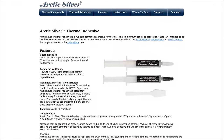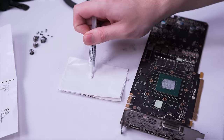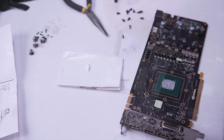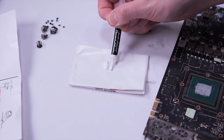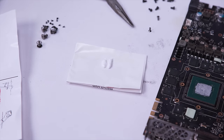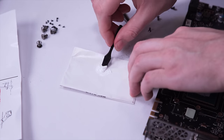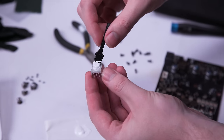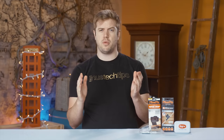Which brings us to our third and final handy sticky product: Arctic Silver Thermal Adhesive. This stuff is the real deal — it includes a warning stating that yes, it is a permanent adhesive. Components that you attach with Arctic Silver Thermal Adhesive will stay attached forever. Your 7 grams of thermal adhesive is split in 3.5 gram parts across syringe A and syringe B. You need to mix these parts like an epoxy in equal 1-to-1 ratios on some sort of tray you don't mind throwing away. After mixing, you can use the included mini spatula to apply the solution to your heatsink or chip or whatever you're trying to stick together. Wait for it to cure, and voila — permanently adhered thermal transfer, with solid performance to boot.